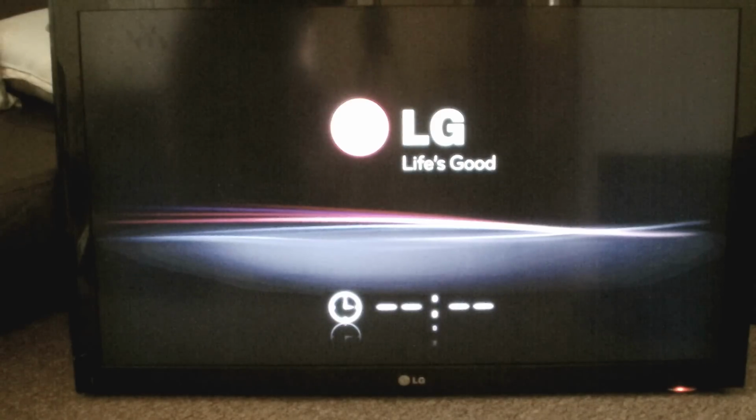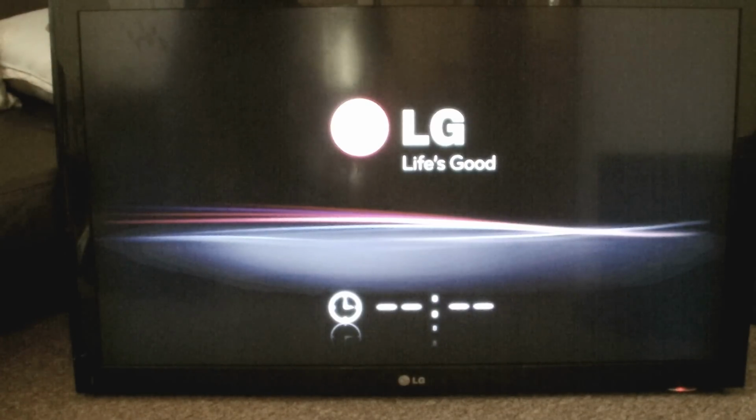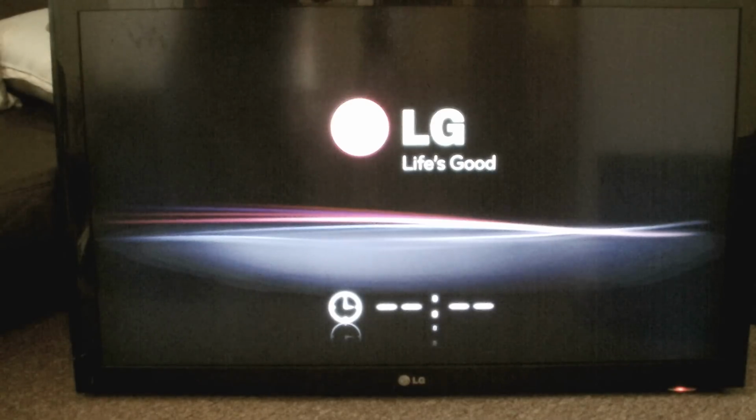We're going to strip this and see if we can get the TV to run with a replacement board. But the first thing I'll say is that there are a few things to try before you do that. One of the first is to see if you can reset the TV using the remote and the buttons on the right hand side. On the right hand side you have power, the OK button, and the menu button, and you also have these buttons on the remote.